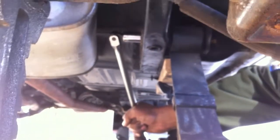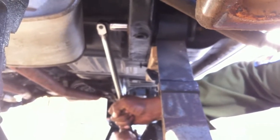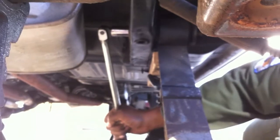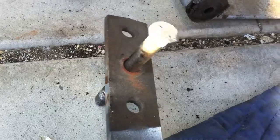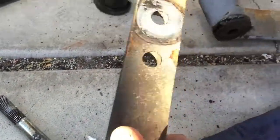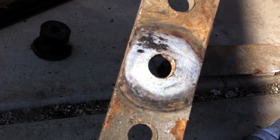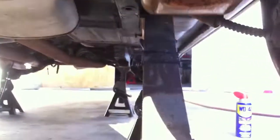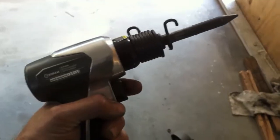These bolts are solid on this car — this is just beyond. It did move slightly — holy crap. This is the wrong bolt to get fused onto a car. It took a heavy hammer hit just to loosen this bolt from the shackle. My suspicion is there's a thin layer of rust that has fused the metal spacers that separate the rubber from the bolt. We may have to sawzall and cut this out.